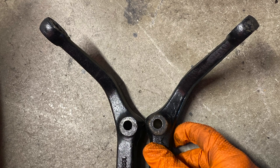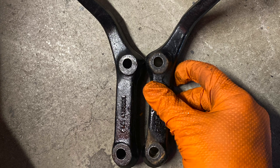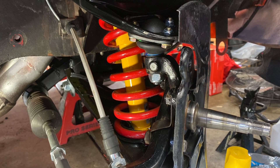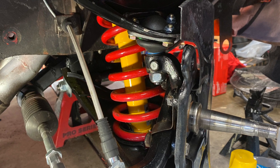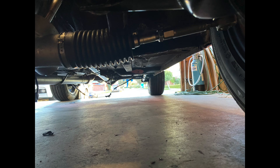One thing I found is that the steering arms themselves are too short, which means they sit too high when there's any weight on the car. When the car is actually on the ground and the suspension is compressed, the points at the ball joint that attach to the rack and pinion are too high up. Driving the car like that would create all kinds of problems — bump steer would be one of them — and it's something I couldn't control.